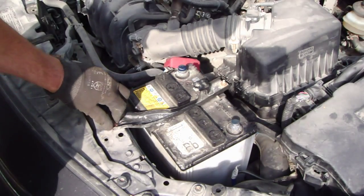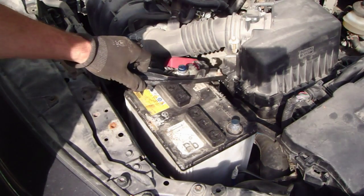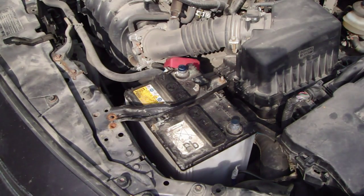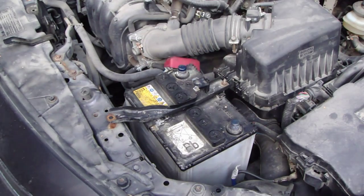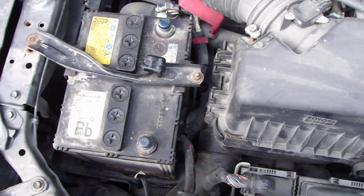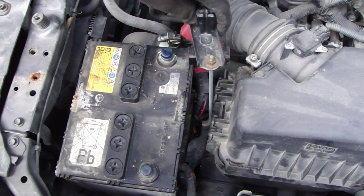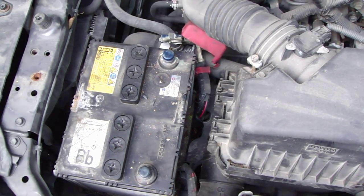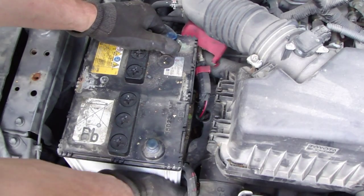And this bolt is good to open first. There is this bolt but it's a little bit rusty, and then when it's free we can take that bolt away. And this part opens, so that there is a little bit complex position. But let's look. There is an idea that I need to move that part in here, and then this hook opens. This is the trick. And now this battery is free, and I can lift out this battery in this way.